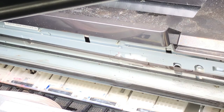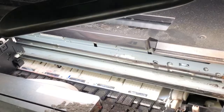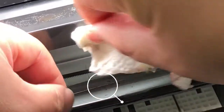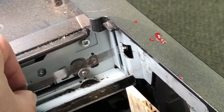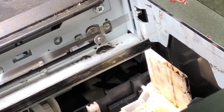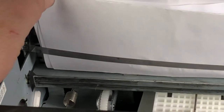When you're cleaning, just use regular warm water or alcohol. This part needs to be cleaned, including all the dried ink up here. I'm using 50% water and 50% alcohol. Put a piece of white paper behind it so you can see the stubborn spots.